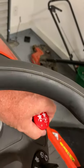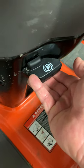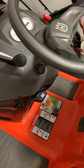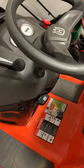You have your blade drop here — you pull it up to drop the blades, then push it down to turn them off. You have your headlights and your brake here. All you have to do is push your brake all the way forward, push this up, and then lock. Let go of this pedal and it locks so you can crank up the mower and run it for three to five minutes before you drive — you want it circulating and warm before you start beating up the mower.